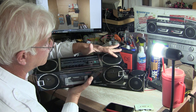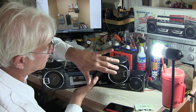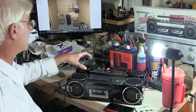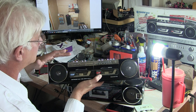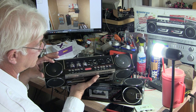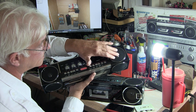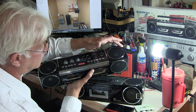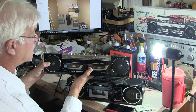This one has a full range sound on top as well as on the front. So if you hit the six-speaker deal it'll give you a full range sound up here as well as on the front. This one here is different - this has a full range sound on the front, and on top these act like tweeters. They look like woofers but they sound like tweeters, because they only give a high frequency sound out of the top, whereas the bass comes out of the front. And you cannot turn these upper speakers off like you can on this model. I just want to explain that difference.